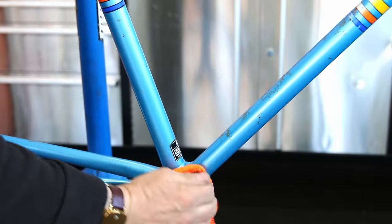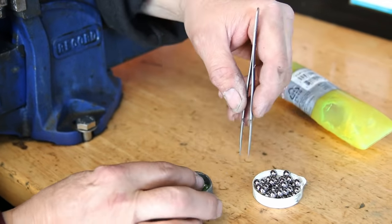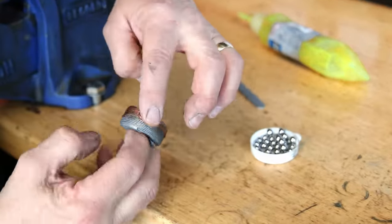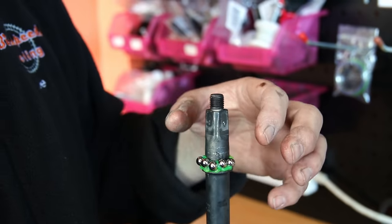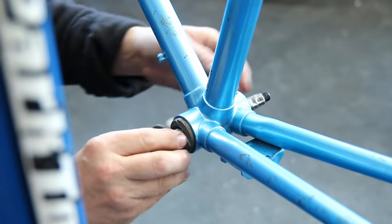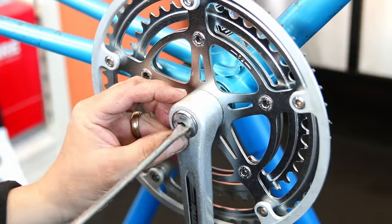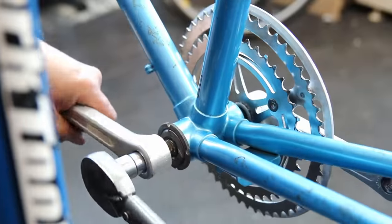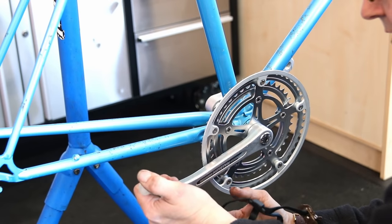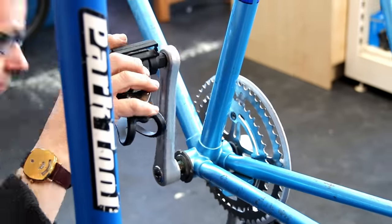We then use a resin polish to bring up and protect that shine — water will sit on the resin polish, protecting the paint in future, giving a lovely finish. You can see how that's now looking beautifully blue again. Now for the bottom bracket — this is a great example of how Shimano premium grease holds a bearing. We put a bit of copper slip on the threads, and look at the way those balls stick against gravity; that's the beauty of that grease. We're not sponsored by Shimano yet, but it's the grease of choice for us for bearing work.